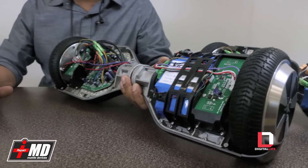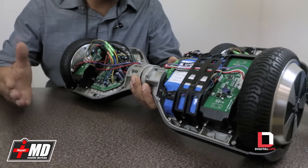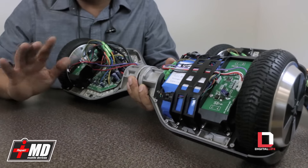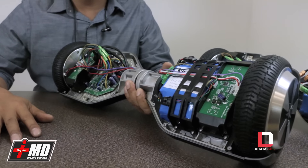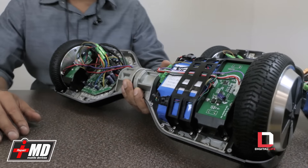If you do have one of the lower end ones, my advice is: watch while you're charging — no more than two hours of charging — and ride it outside. The moment you see smoke, get off the board and just let it be. Don't spray it with a garden hose because you don't put water on an electrical fire — you just make it worse.